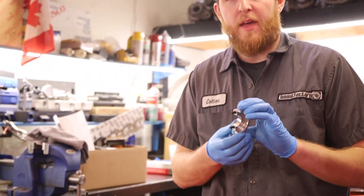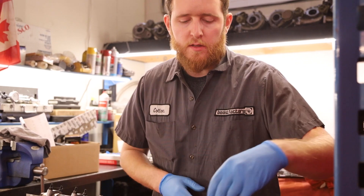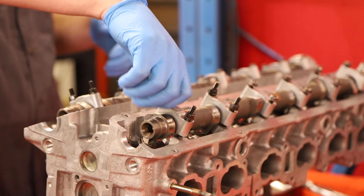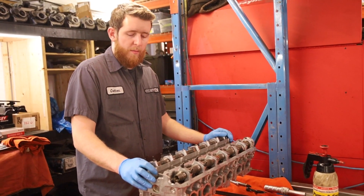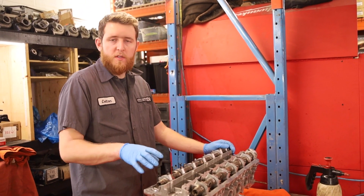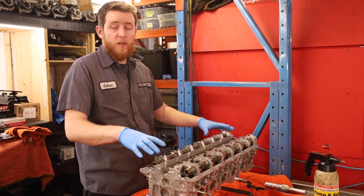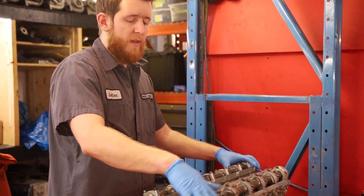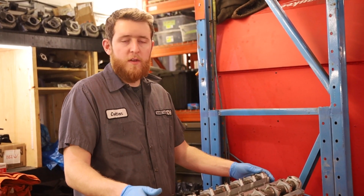One thing to note on the cam caps: this is just a temporary install. There is sealant that goes here — we remove these after when we go to install the cam seal and we will silicone seal them as well. We're going to be shimming this cylinder head in the next video. This is a Neo cylinder head from an RB25, so the shim system is a little different — more similar to a 2JZ than an RB26. The torque spec for the cam caps is 8.7 foot-pounds. We're missing the oil deflector plates but we'll get to that in the shimming video. That's a basic quick rundown on the RB25 Neo cylinder head assembly.